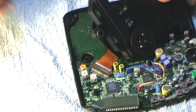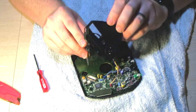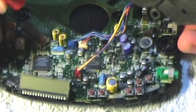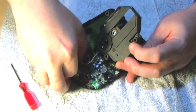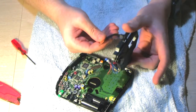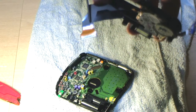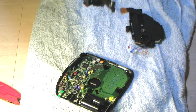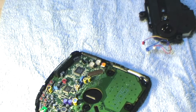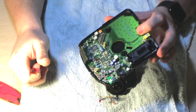Here is the entire CD unit. Down here there's a little ribbon cable. To remove it I push the handles forward like this and the ribbon cable comes out. Then there's a blue connector and a white cable that need to be removed so we can detach this from the main board. With those unplugged the entire piece is out.